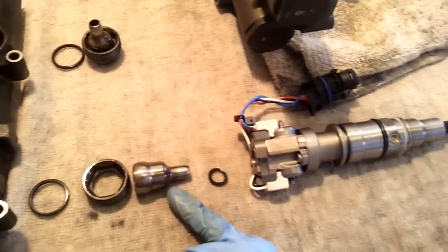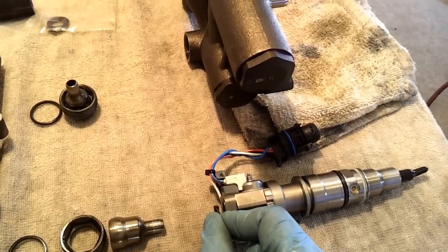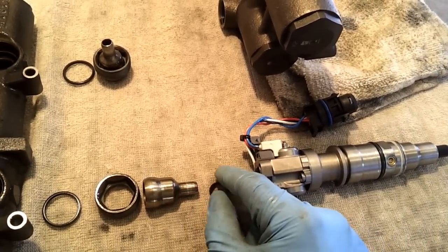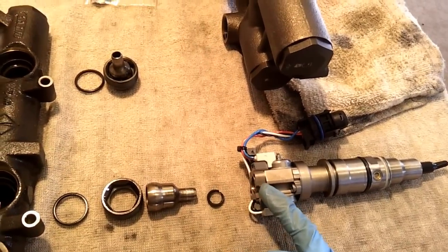The nipple cup is the part that actually goes down into the fuel injector, and it's sealed by a top injector seal or O-ring in the top of your injector. A leak at this point is actually going to show up first as a leak in the top of your injector.